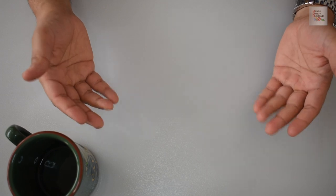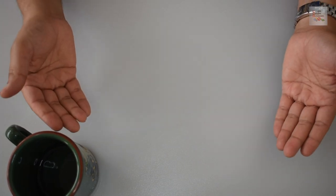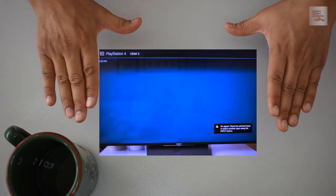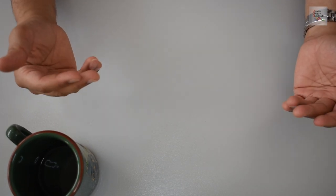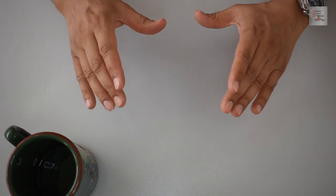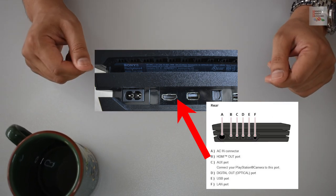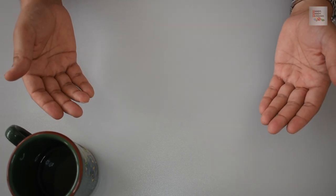Many people have experienced issues with their PlayStation 4 relating to the console being unable to send a signal to the TV screen. I have noticed that some electronic repair specialists on YouTube and otherwise have claimed that this is due to an inherent weakness in the HDMI port. Typically, repair centers recommend replacing the HDMI port for this reason.